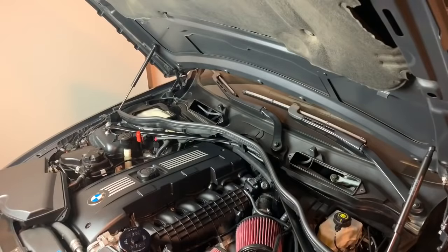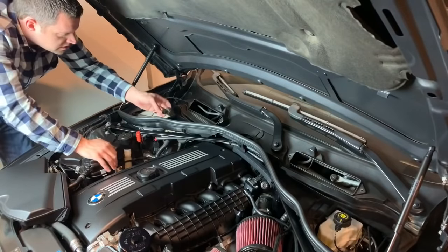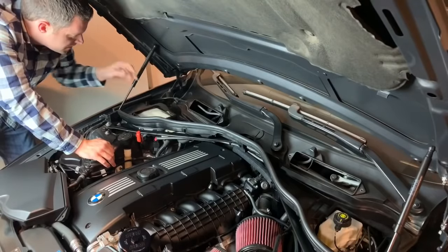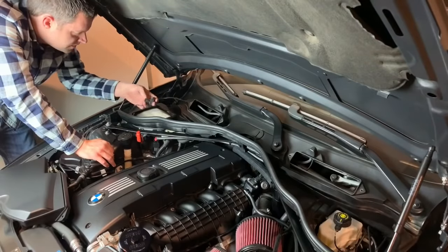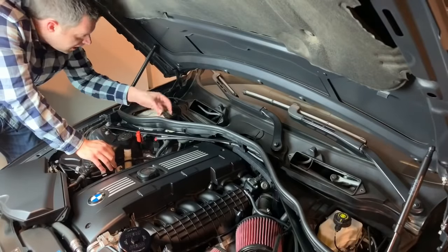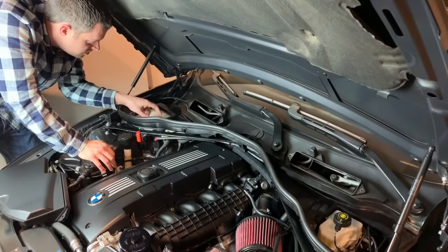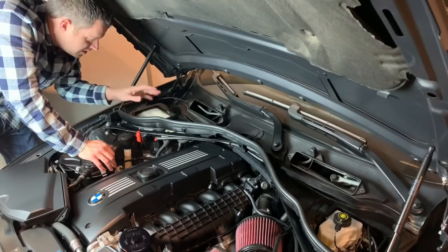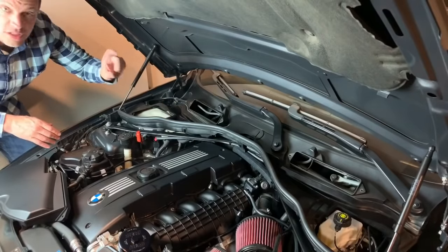We'll start on the left side here. Now, one thing with this swap is that your sensor for your recirculating doesn't meet all the way here with the connection, like where you would actually put it in at. So what you could do is cut the wires and extend it so it can reach. However, this is only activated when you hit the recirculating and do the A on there. I never ever use that. So I'm just gonna leave it right up in here, protected from the elements, and not even worry about it. But if you guys want to extend it, you can extend it so it can connect over here, but it's just a little bit short.